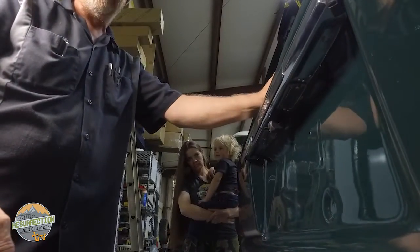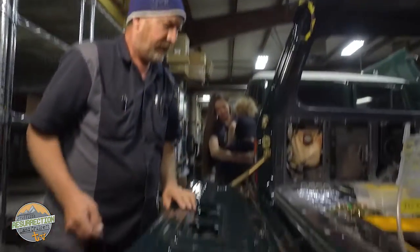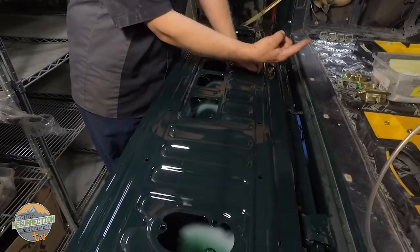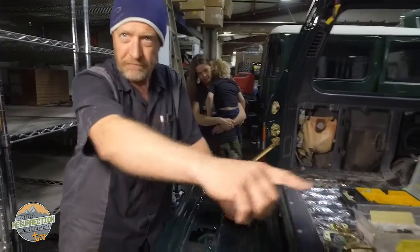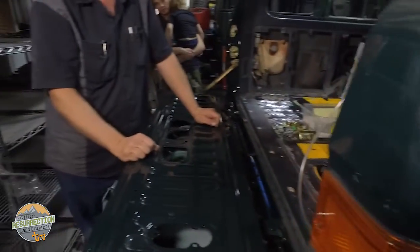And then I'm going to open this tailgate — you need to bring it in through the body and into the main wire harness up behind the spare tire, and off into your fender, all going through the proper body grommets. All just so we can see out the back with the camera.